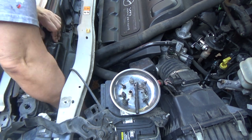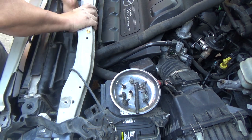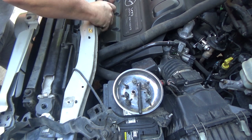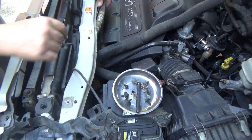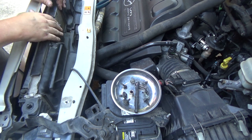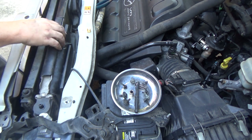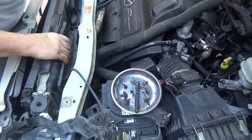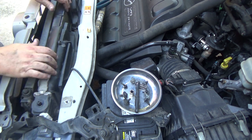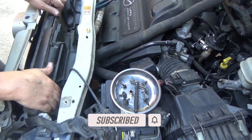Okay, I'm going to go ahead. Okay, the fan. I'm just going to put those in there because it holds that bracket out of my way. The fan bolts are 8mm. Yeah, the radiator's just sitting down in a couple rubber grommets. So if I can get everything from the top, that's going to be the way to do this job. So I think I've got all the hoses. There's one going to be left down there.